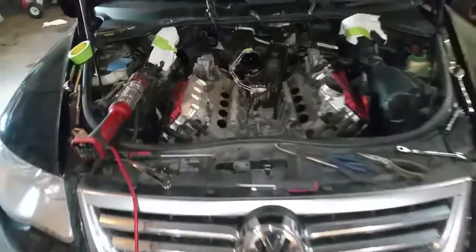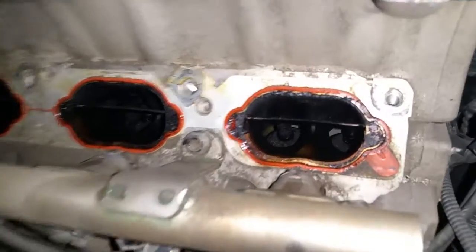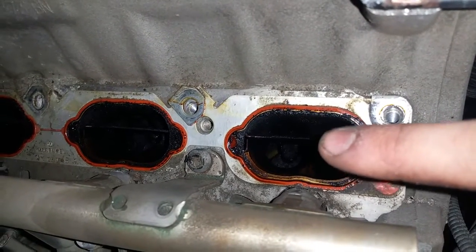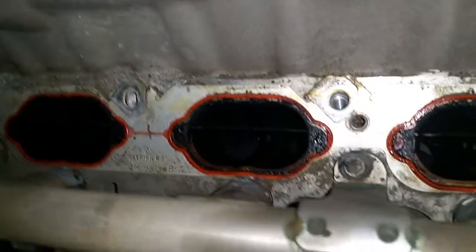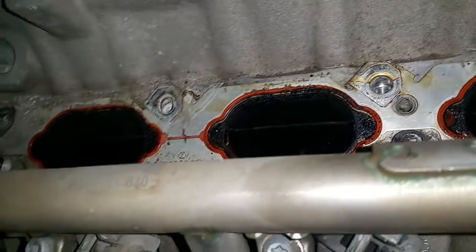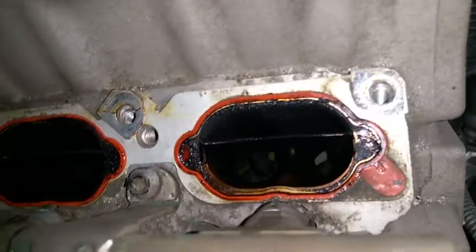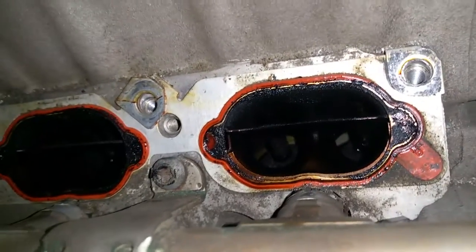So anyways, this is what my intake ports look like. You can see — it's a little bit hard to see — but you can see all the carbon on the valve right down at the bottom there, and all the carbon around the valve stem. There's also lots of carbon build-up in the port wall here. In certain sections it's probably about a millimeter or two thick, and around the valve stems it's a good millimeter to maybe three millimeters thick in some spots.